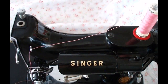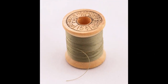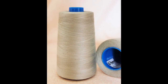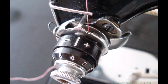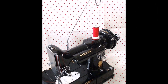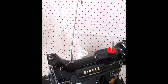Furthermore, it is important that the thread flow smoothly to the tension unit. The Singer Featherweight was designed in a day when small wooden thread spools were the norm. Today, however, in a quilting environment, threads come on large cross-wound spools or on heavier cones. As the thread is fed into the upper tension unit from one of these heavier spools or cones, the machine struggles to feed the thread and creates a jerking action, resulting in inconsistent, skipped, or too-tight stitches. A thread stand designed specifically for the Singer Featherweight is the perfect remedy — it lifts the thread off the heavy spool or cone and allows for a smooth, even flow of thread through the tension discs onto the needle.